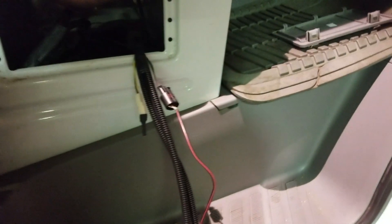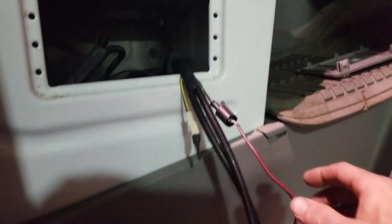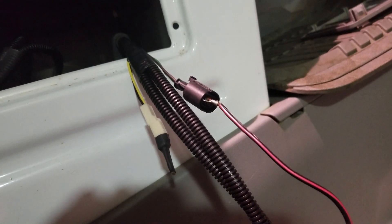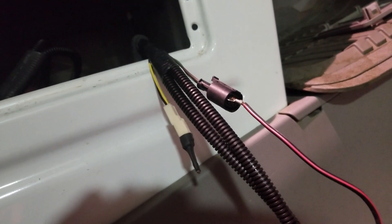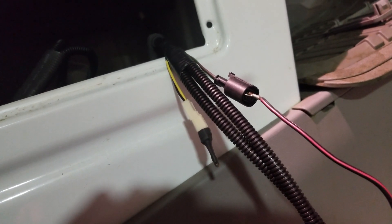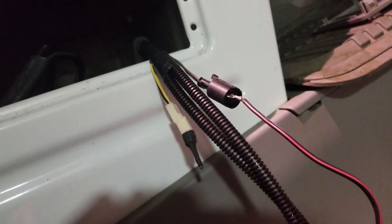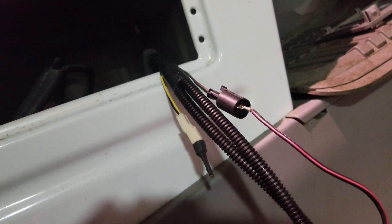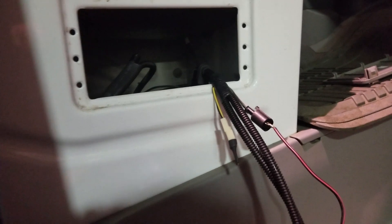When I pull that out, you'll see it — I just crimped a little piece of metal onto the end of this wire and stuck it in there. You could do it with a paper clip too, just need to stick something into that terminal. You don't want to cut that pigtail off — you might need it later — but it has to be grounded somehow. Just ground it this way, simply onto the negative.